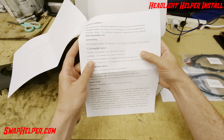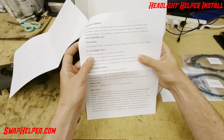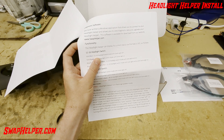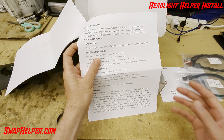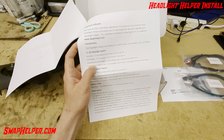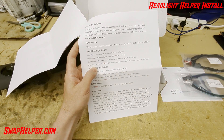The instructions go through the various modes you can expect to see. If you have an 11-16 headlight switch, the LED indicator is going to be blue. Solid blue means the Headlight Helper is on and awake in 11-16 mode with the dome light off. Solid purple means it's in 11-16 mode with the dome light on. If you see it breathing from blue to black or blue to off, that means it's in 11-16 headlight switch mode with the auto lights active. And if you see it breathing from purple to red, that means the Headlight Helper is in 11-16 mode with auto lights and the dome light on.